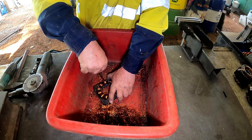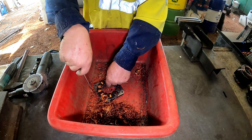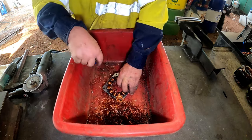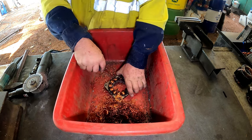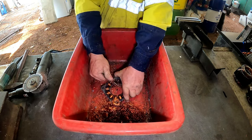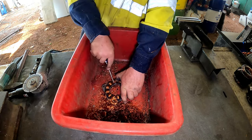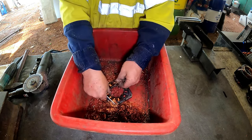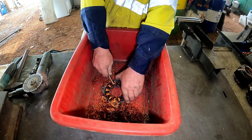So if you do washing machines and you're picking them up in your scrap pickups, take them home. Plug them in. See if they do a spin cycle. If they do a spin cycle, put a bit of water into them. Plug the hoses in if you've got the hoses. Hoses are only about $30 if you haven't got them. But usually they're throwing them away with them anyway. Strangely enough, I've got an abundance of hoses laying around here. It's unbelievable.